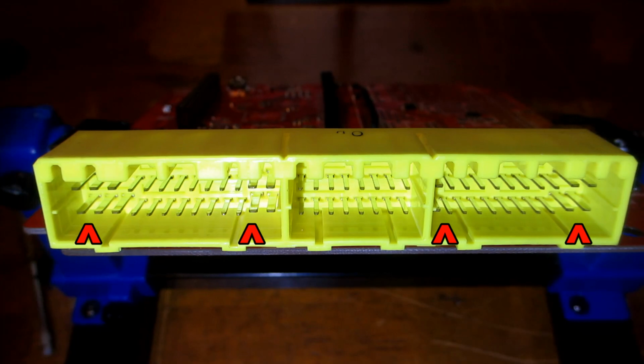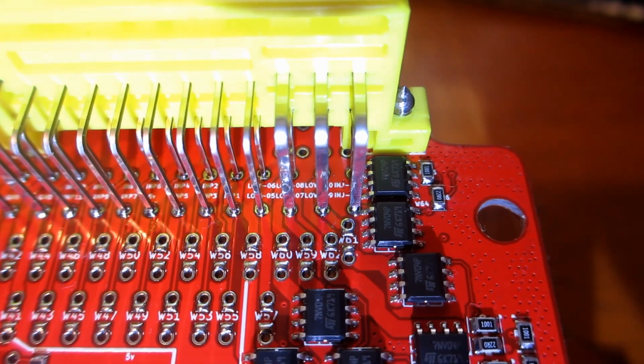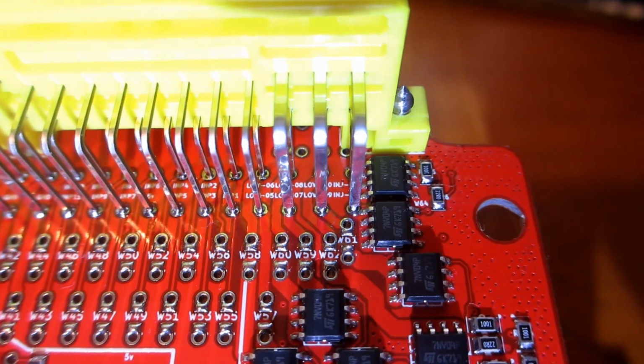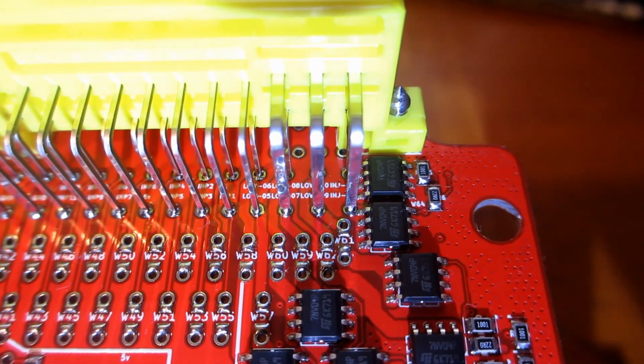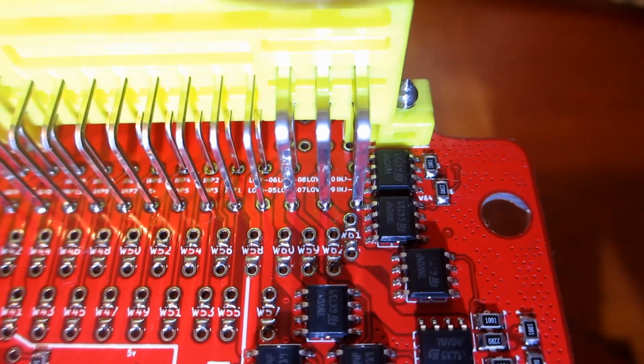Just on a side note, there's larger high current pins on the connector, and 0805 jumpers seems to work fine even with two high Z injectors on one pin, but there is the option of putting a higher current link across those. I might run 1206s with those pins.